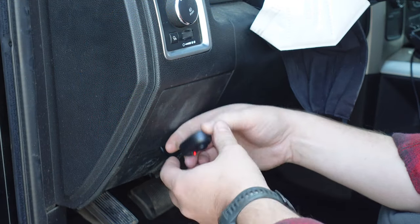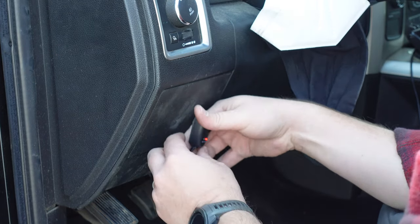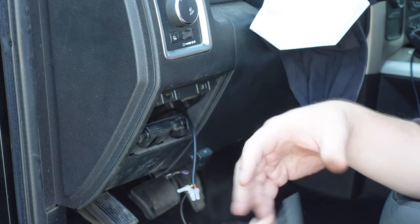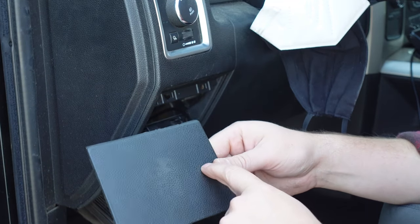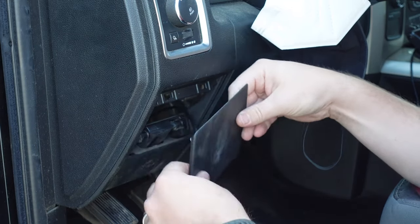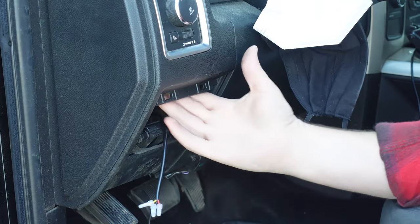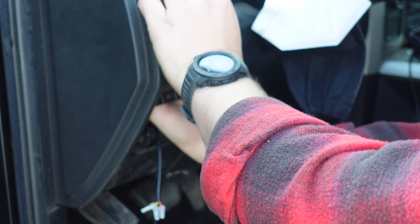Here's my original toggle switch — it had this little sticky tape that would just stick there and fall off whenever you didn't want it to. And I found out by running my wire through here, I made this nice little panel launcher — bam — and it would just shoot it off when you're trying to undo your parking brake. But that's the panel I'm going to use. I'm going to cut this out in the center, mount those switches right here, and then it will go back up in there. Three light switches here, and I'm going to be wiring into my dimmer switch.